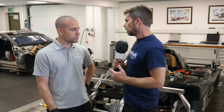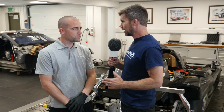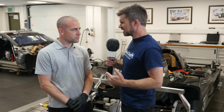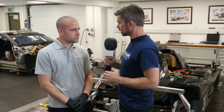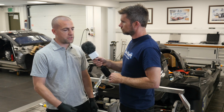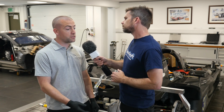Okay, so you've talked about the camber there, measuring toe. Now, again, coming from a road car background, particularly the hobbyist, enthusiast level, it's quite common to take your car along to a wheel alignment specialist where they may be using a laser or camera-based wheel alignment machine, and instead, behind me, you're using strings to set this up. Yep. Now, a lot of people might think on face value this sounds backyardish or pretty rudimentary, but again, you're operating at LMP2. This is very high-level motorsport, and strings are still acceptable. Can you tell us why you favour strings and how they work? I just feel that they can be measured, and it's a quantity that can be seen, and obviously with flying around the world, it's something that can be constantly checked and zeroed, whereas with lasers, if you have a system that's complex and it goes out of tolerance, you may not be able to rectify that or even spot it.